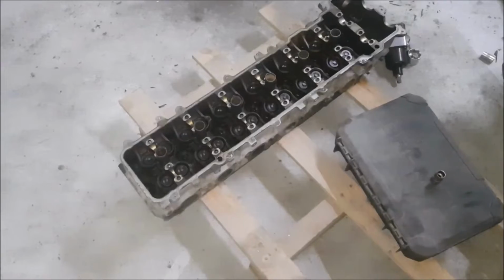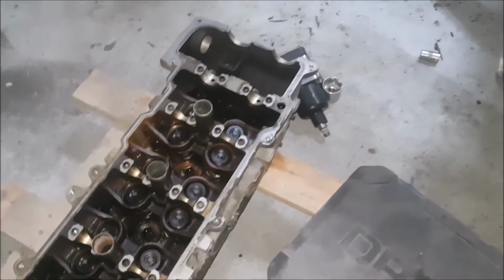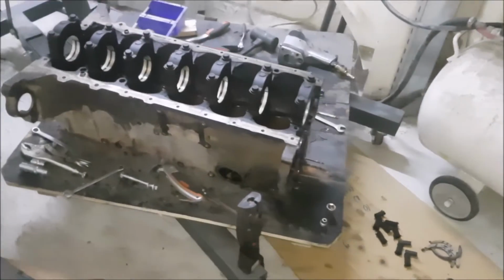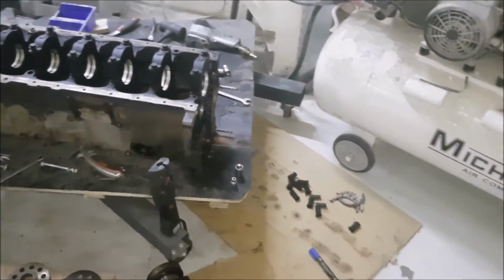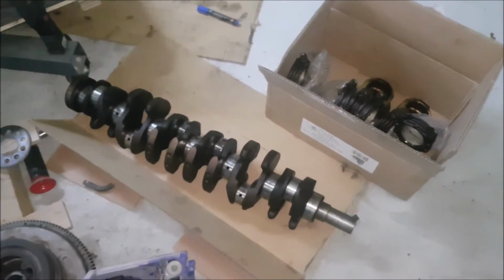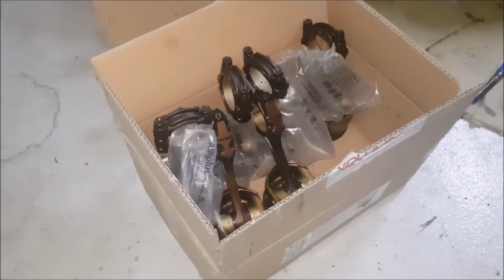With the engine out of the truck and in pieces, it's time to get to the machine shop. And here it is. Primarily cylinder 1 that needs some work. Then a good clean for everything, new bearings, new piston rings, and we should be good to go. See you next time when we head off to the machine shop with the parts.